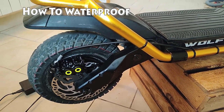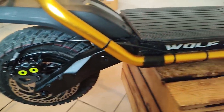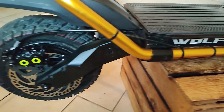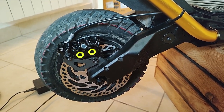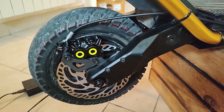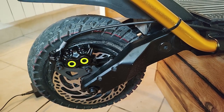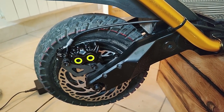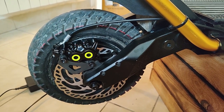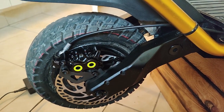Okay, just a quick shot of her being relatively done. A couple of quick things I want to mention. I know this video is probably long. I did the Magura quick bleed procedure where you do it on top there at the lever like 5 times. I still don't have great lever feel. The engagement point is too low, so I'm going to have to do a full bleed. We'll do that a little bit later. Don't have time for it now.